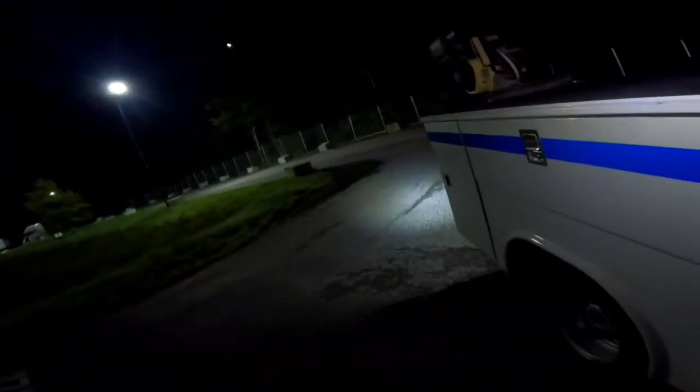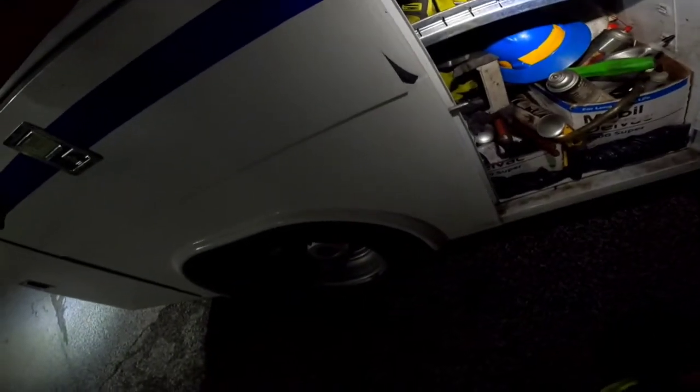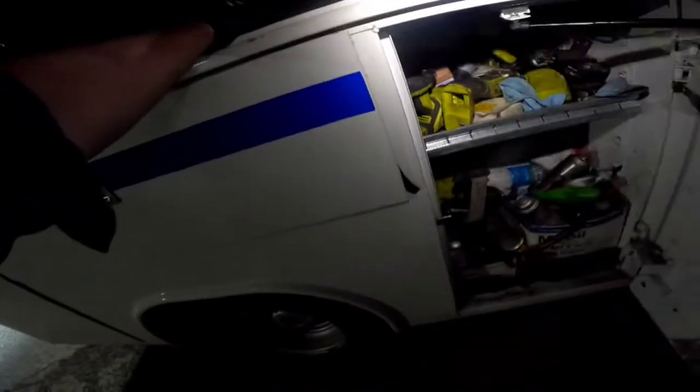All right, let's open up the front box and see what's going on. His look all right. All right, so we're gonna crack this box open and see what's in there. See if maybe wires touching. You can see it dimly blinking. It can't be a real ground issue because then it should affect the whole trailer. So we're gonna see what's going on with it.